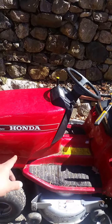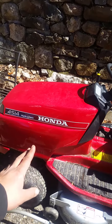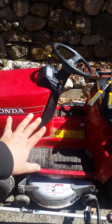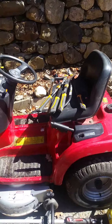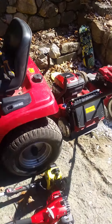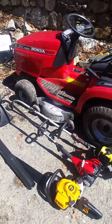On this one I did an oil change, changed the spark plugs, put new blades on, and put a new belt on it, so this is good to go. I got my regular hand tools for the jobs too. I'm ready for the season.